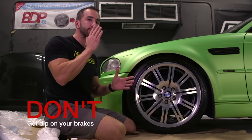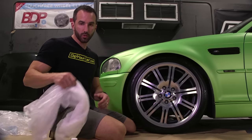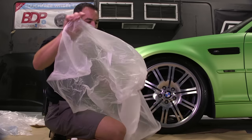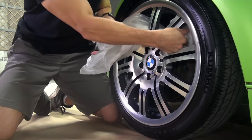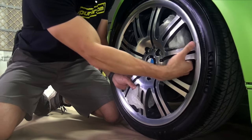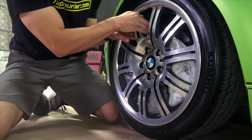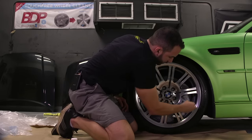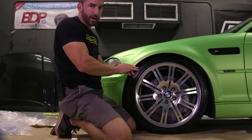If you're going to leave the wheels on the car, don't spray directly over the brakes — you have to mask them off. In the DYC wheel kits you get a brake masking bag for each wheel. It's a very simple technique: open up the plastic bag, thread it through the spokes of the wheel, work it over the brakes, and completely mask off those brake areas. We don't want any overspray on the rotors or calipers. It only takes about 45 seconds per wheel.